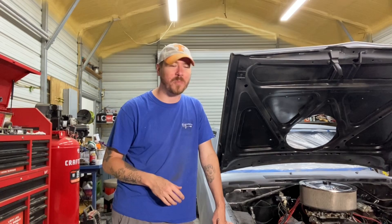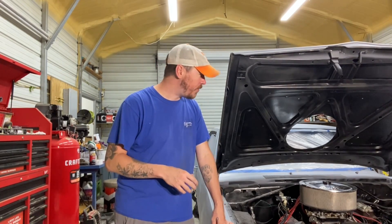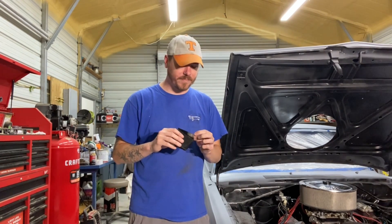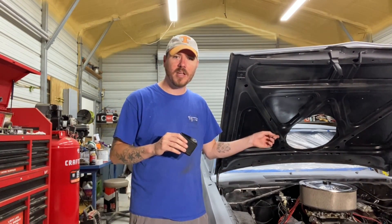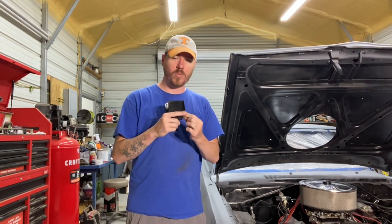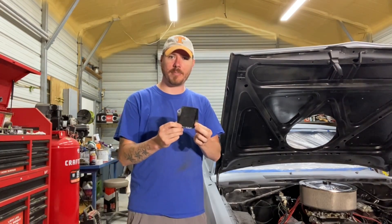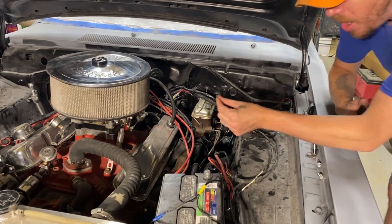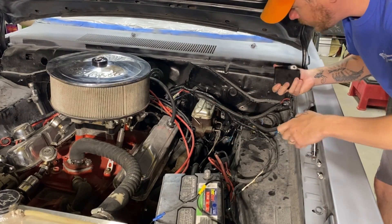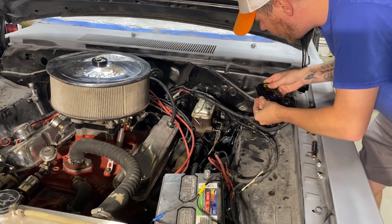I love cheap parts — there's nothing wrong with some cheap parts. I try to keep it budget-friendly. This one almost cost me the whole project. So the firewall is nice and clean. I'm going to find another washer to go on the back side of that cable that I made — my ground strap. We're going to go from the ground strap to here, washer on the back side, connect it back to the car. I got two washers. It would help to have some star washers, but I don't have any. So let's just go ahead and slam this back on.